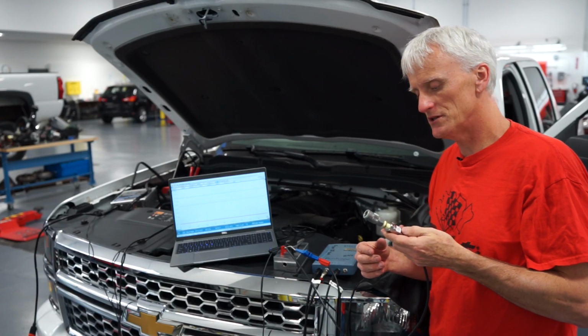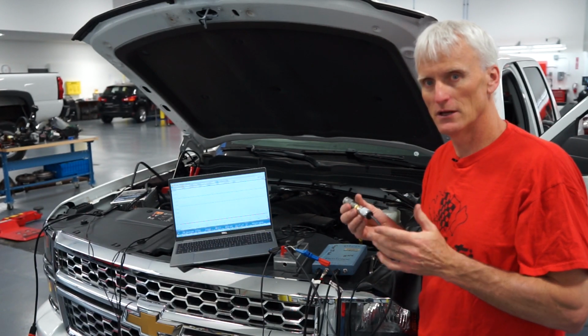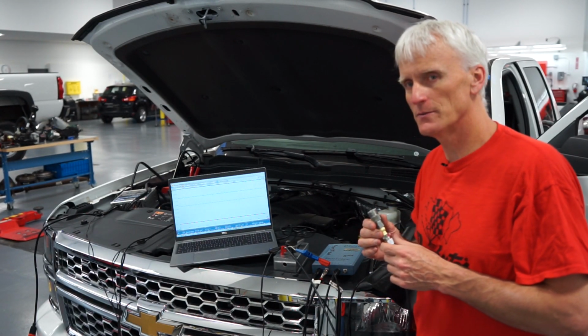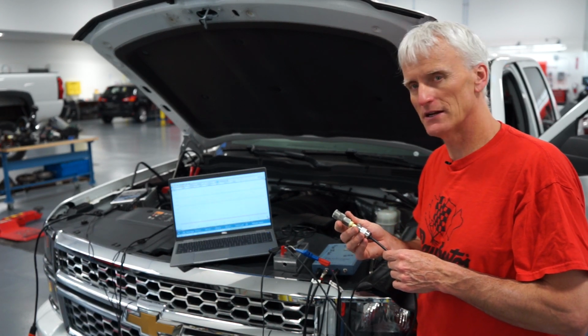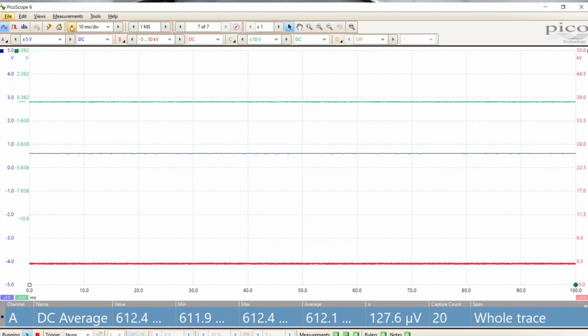The last sensor we're going to check is this SSI Technologies sensor. It's a 500 psi transducer, absolute, just like the Honeywell 500. You can see the values are probably going to be pretty similar, but we're going to go ahead and set a custom probe up for it anyway. Looks like we're at about 612 millivolts, 400 feet above sea level.